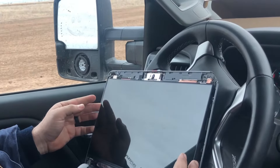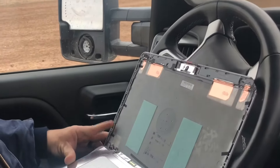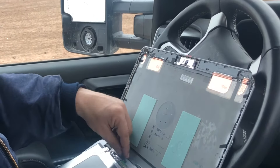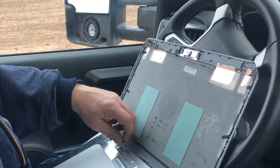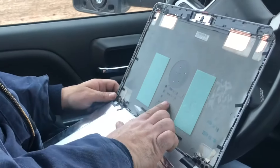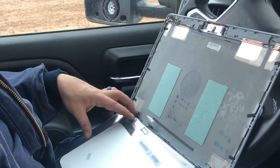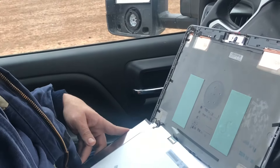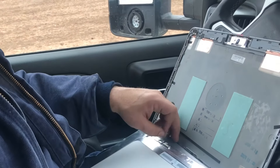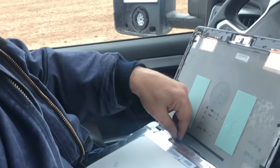This is the LCD I ordered. To make sure you get the one you want, you're going to look on the back of your computer — it's going to say a model number. You're going to find that model number, and I just always type mine in on eBay. I ordered this screen off eBay — this was an HP G40 or 840 G3. I just typed in 'HP 840 G3 LCD replacement screen' and looked at the reviews, and this one was $50.